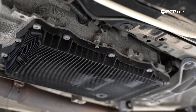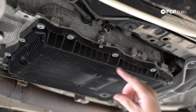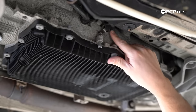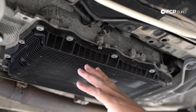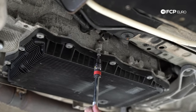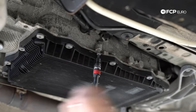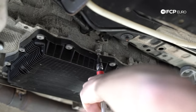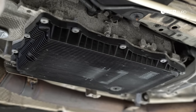With this timing chain process we're going to have to be able to rotate the engine. The transmission is in park right now, so to release it from park we're actually going to tighten this five millimeter screw up — you can see it's going to push on this lever. This lever releases the parking claw in the transmission and puts the transmission into neutral. Using a five millimeter allen, we go up in here and tighten this down, and you will hear the transmission click out of gear. Now we're in neutral.